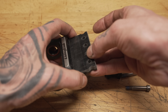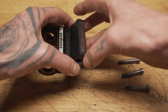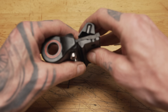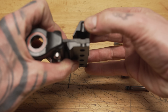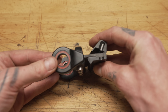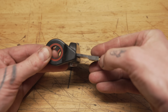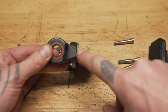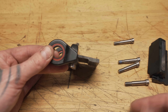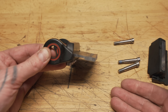Spot bolts this on top of the chainstay bridge, this goes on top of that just like so. This is your cap that goes on top, and then the bolts thread through from underneath. So it's actually flexing over that point right there — pretty neat. If you look closely at the carbon leaf spring, you can see that they've used a bunch of different layers of carbon. More carbon means it's going to be stiffer; less carbon and it's going to be more flexible. That's what they mean when they say this is tuned to flex the amount that they want it to.